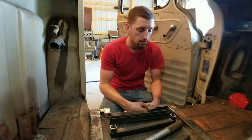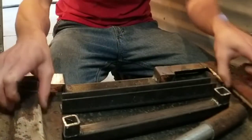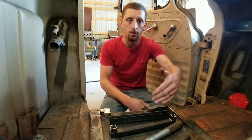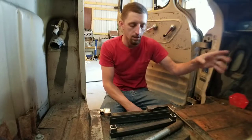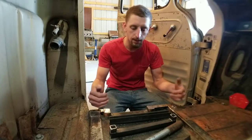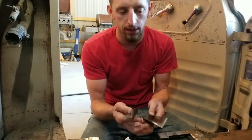I have already done a little bit of prep work inside the cab. I had to extend the factory seat rail out a couple of inches due to the fact that I've had to move my seats farther apart because I'm actually changing the driving location on this truck. So I moved them out a couple of inches. My thought for the seat and the frame was to use inch and a quarter angle and a piece of one inch angle, eighth wall.